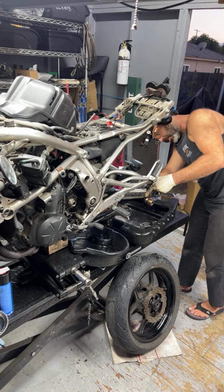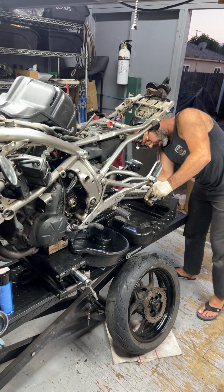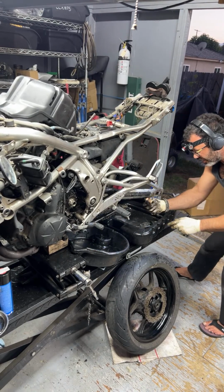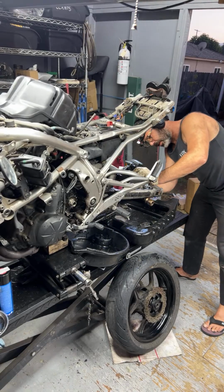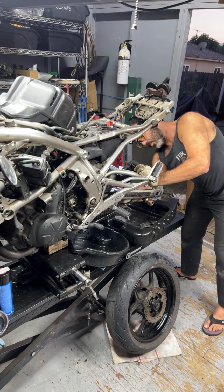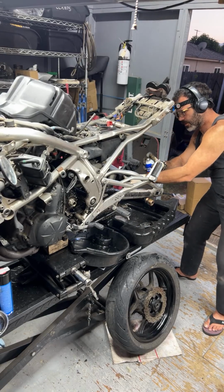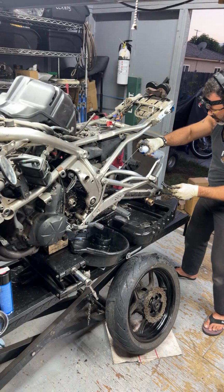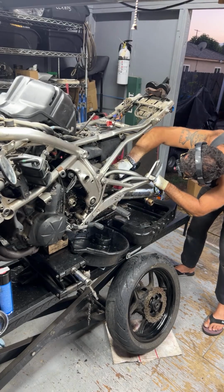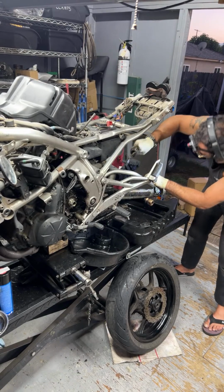Using a nylon bristle brush and basically hand scrub the whole bike, or at least the sections that we're going to be servicing. That's almost like the best way. That doesn't need to be scrubbed, but you still don't want this grease to make its way onto the tire. That's probably the worst thing. Grease and rubber and asphalt do not mix very well. Provides extra loss of friction.